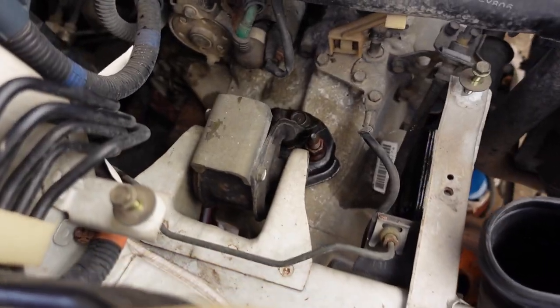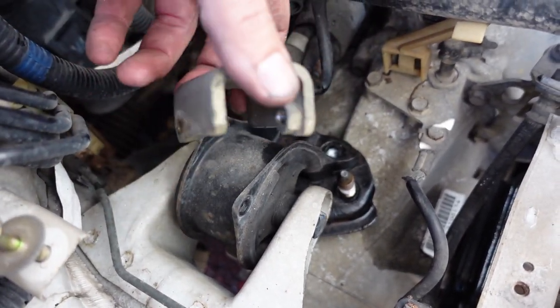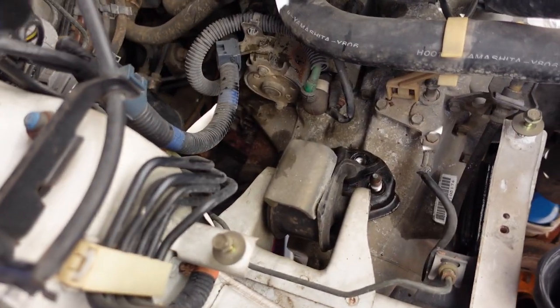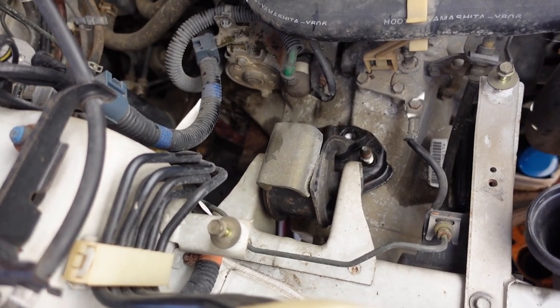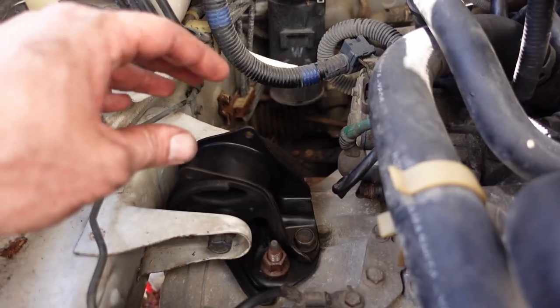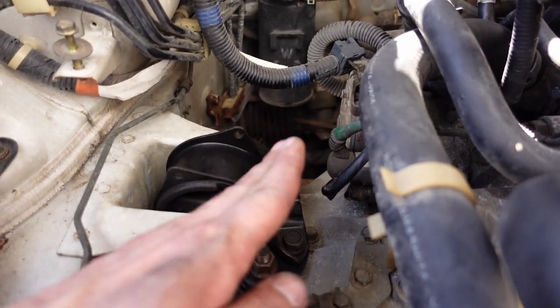The rest of the air box is out. Jack is underneath the trans. I'm going to get this motor mount out. Here's a curious one — maybe one of you guys know. So this is the SIRG mount, the old one. It has this steel bracket, looks like a U-shape on top. Here's the Type R one — it looks like it has the provisions for it, but it looks like it never had it mounted. So is that like a vibration thing? And the Type R is more race car, less weight, so they just ditched it. Old, fatigued, and cracked out. New motor mount is in — no dramas. OEM parts drop in exactly how they should. It fits in there one way: this width fits between these and then you hit the angle just right and the base clears the studs and falls right into place.